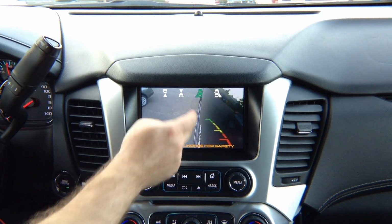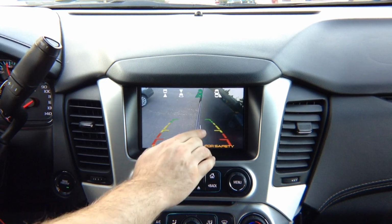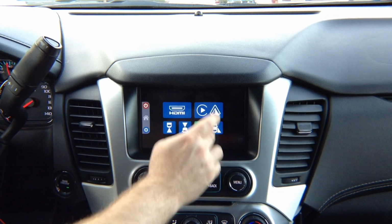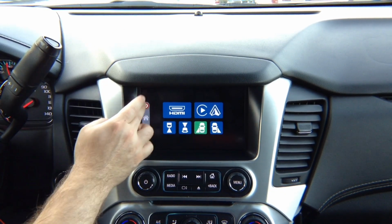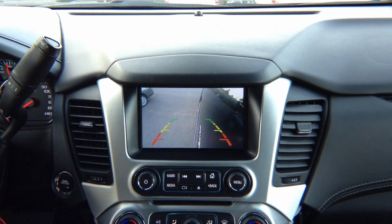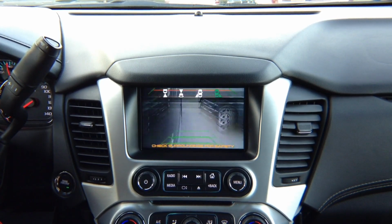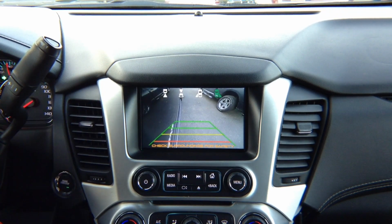So, for example, you see with left turn signal, we got left camera. With right turn signal, we got right camera, right? But if you did not add any of the cameras, nothing is going to happen. So if you're in the factory menu and I put left turn signal, you got left camera. If you did not install left camera, it will not turn on. In the right hand signal you see right camera. If you did not install right camera, the right camera will not turn on.